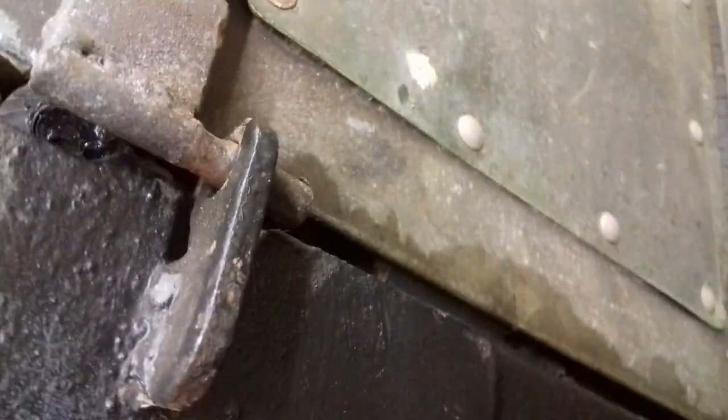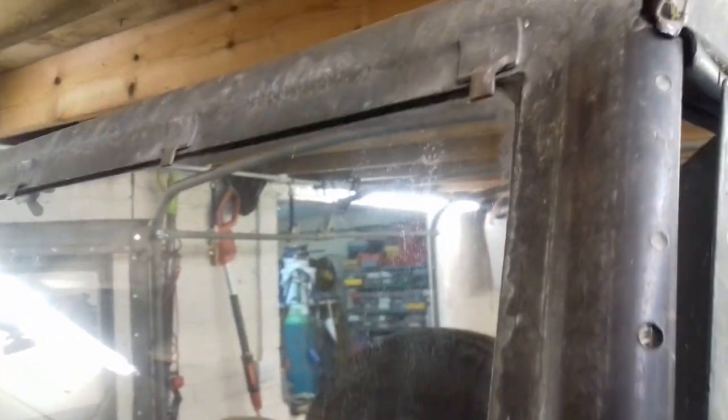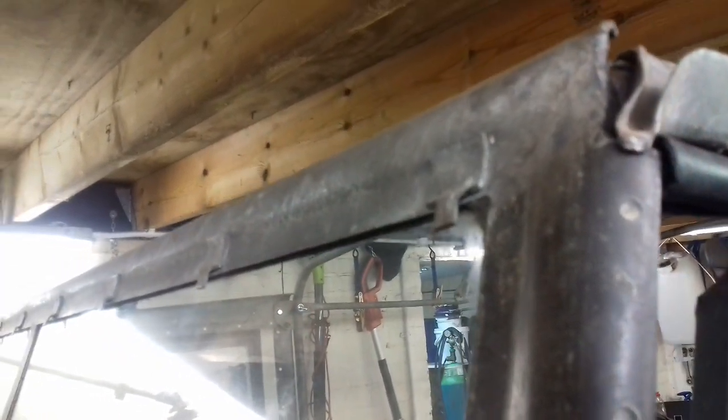Also the thing I've got is this bloody gap on here. I'm not sure what I can do about that. I don't know if the windscreen needs to sort of come back a little bit more. Maybe I'll take these two tops off and see if I can get the windscreen to come back a bit more. Because the gap's down here — it doesn't look like it's catching on there, but there's that sealing rubber so it should be okay. That doesn't look like it's fitting properly, so I might take these two tops off, this one and the other side, and see if I can just align the door up with the windscreen.